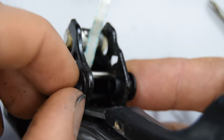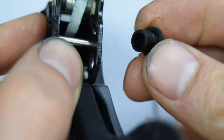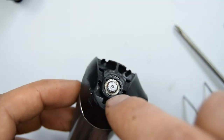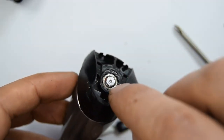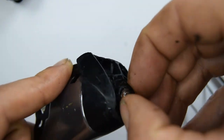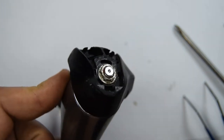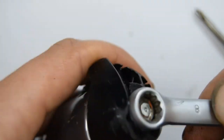Where we took off the lever there are two bushings - you can take them off if you're going to do a full clean. My levers lost the plastic covers on the top. There's just a screw here that you lift up and take off, and then it exposes this nut attached to a bolt. This whole plastic cover - we need to remove it and possibly this screw here on the top. It looks like a number 8, so you'll need a number 8 socket or potentially a wrench.